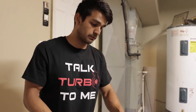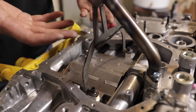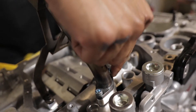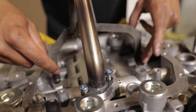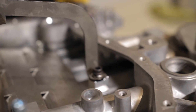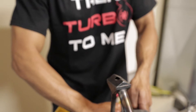They include a spacer to bring the oil pickup tube further down into the oil pan. With the spacer, make sure the blue bolts are up top where it connects to the oil pump, and the black bolts — which are supplied with the spacers — go in the back. The holding bracket goes through the baffle. The ones in the back have nothing supporting them, so you have to make sure to get it in there correctly.